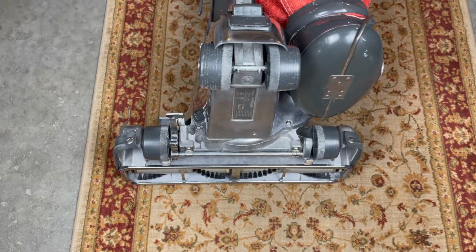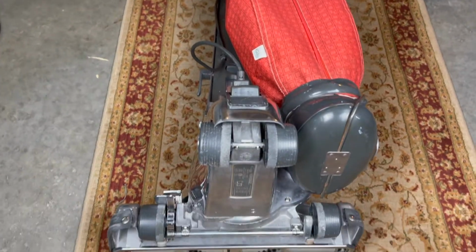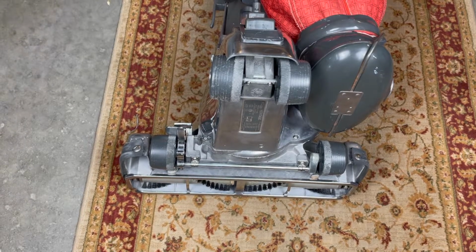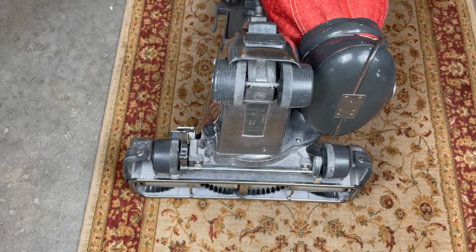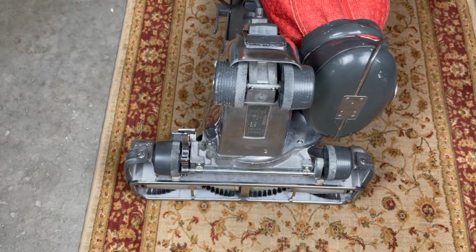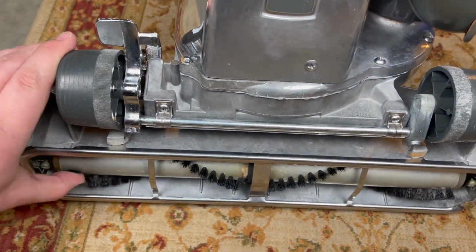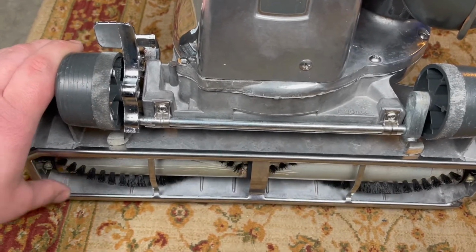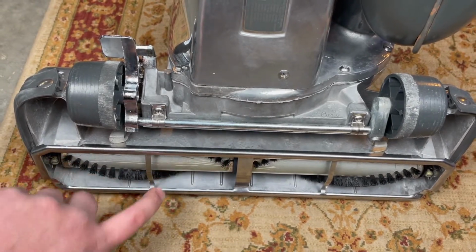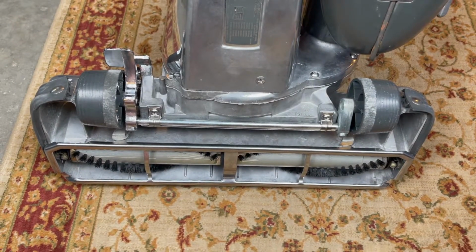So the Heritage 1 is in position for our Brushroll speed test. And I just want to show you, so this Brushroll, I did re-lubricate the bearings on it. The bristles are actually in pretty good condition, so I didn't think it warranted a new one. But you can see one casualty here of the restore is I was a bonehead and was scrubbing this Brushroll in the sink. And then all of a sudden, I was like, oh my goodness, the paint is coming off. So there's some really ugly scratches in there, but that doesn't affect the use of it, obviously.